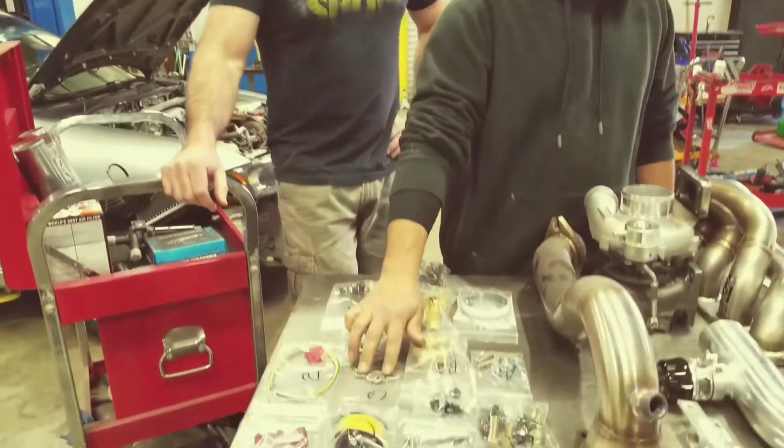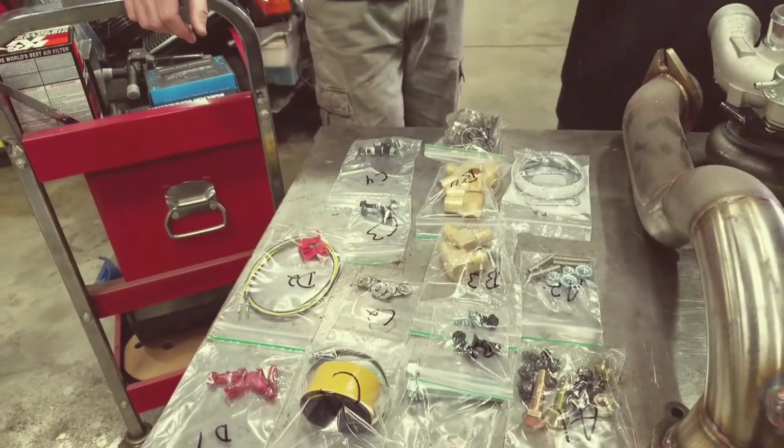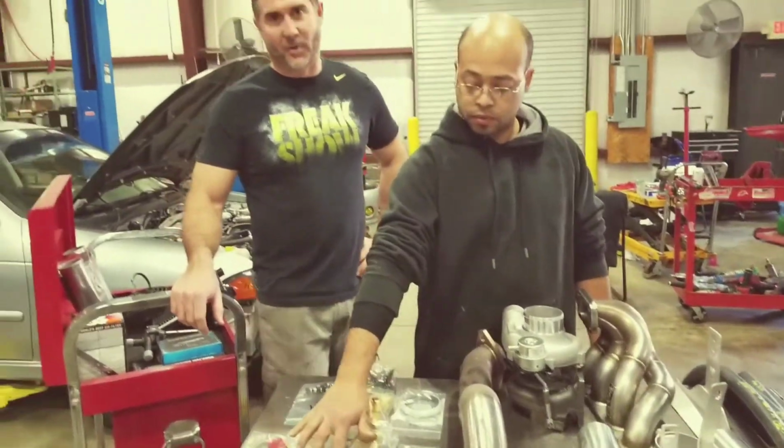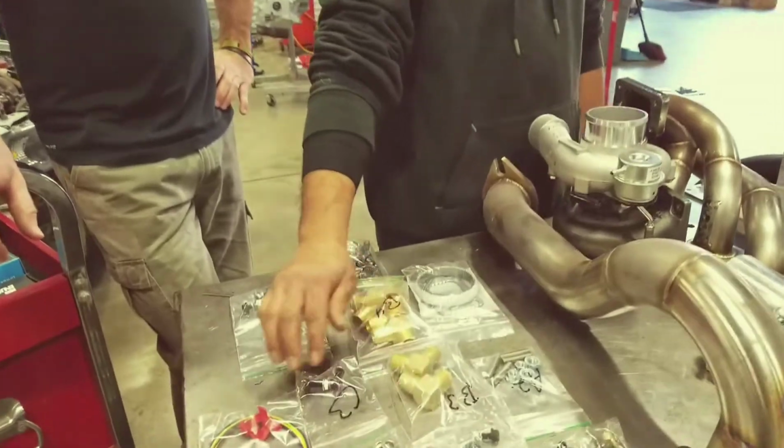C2 is a bunch of washers that's going to go behind your crash bar, to space the crash bar out some, so stuff won't be hidden. 3 washers per side behind the crash bar.